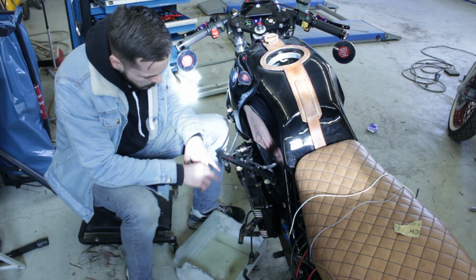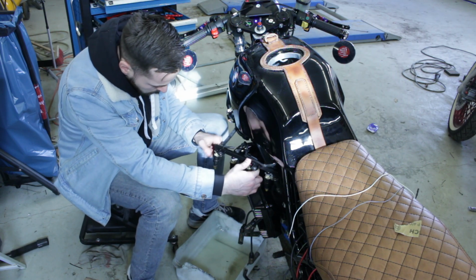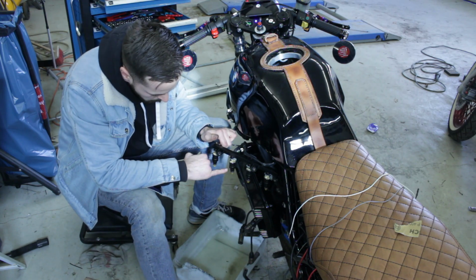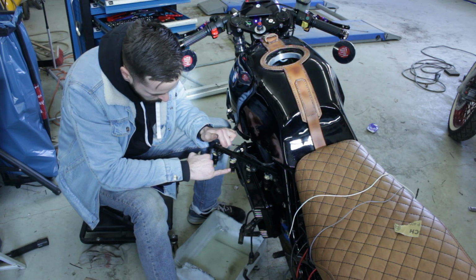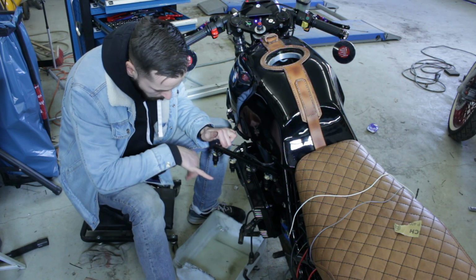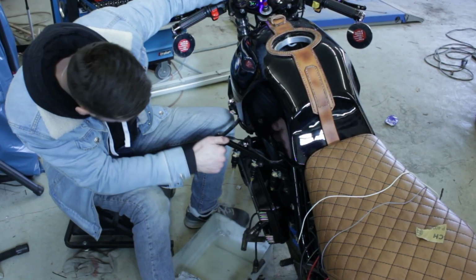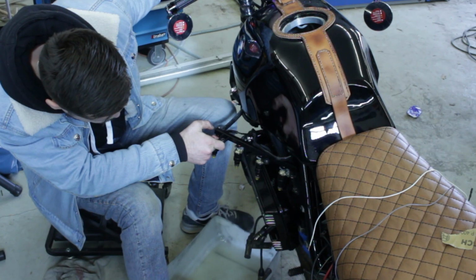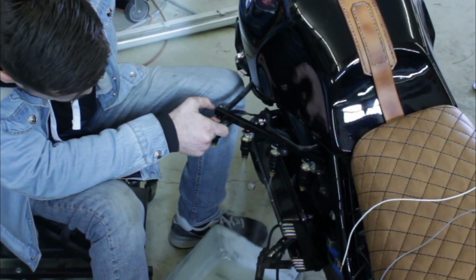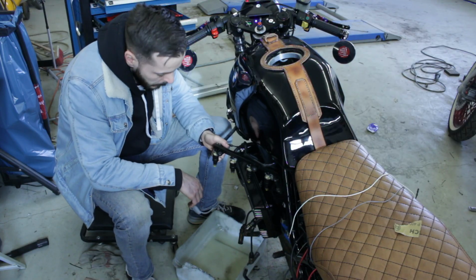So I changed injector 1 to 3. Now we are going to see what is going on. Now the injectors are damaged. We should be able to see the injectors in cylinder 2 and 3 now overflowing the system. Cylinder 1 nothing, cylinder 4 nothing. Yeah, exactly how I expected it.